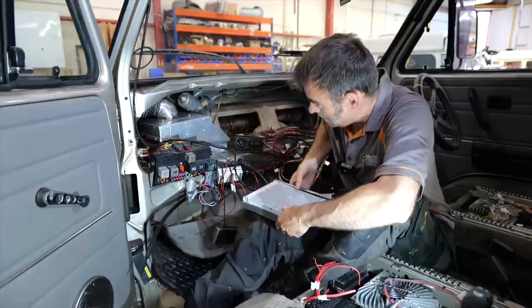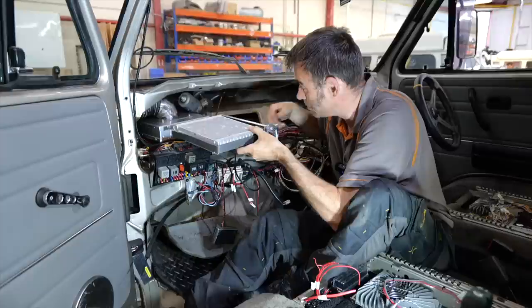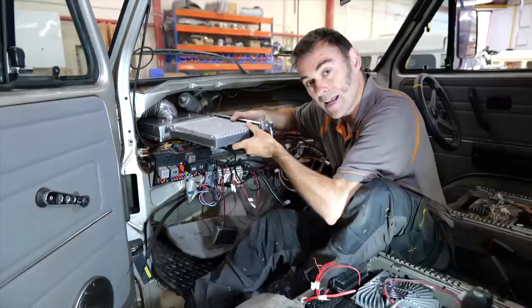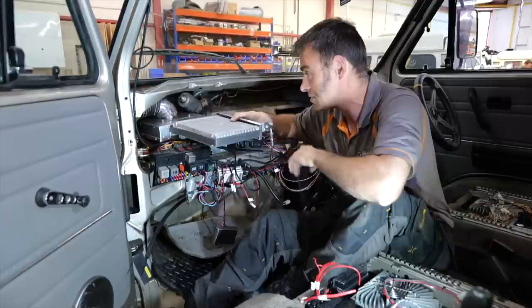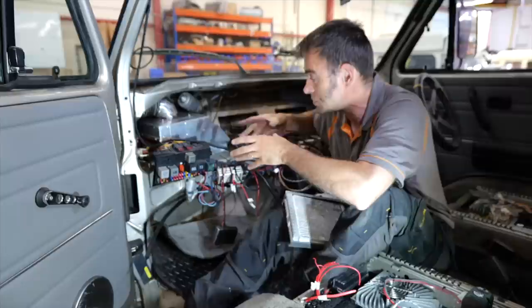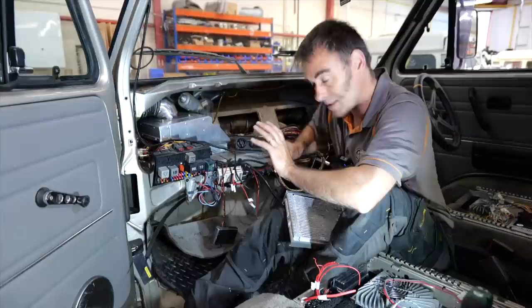When you're in Egypt, you're going to need the air conditioning evaporator. Outside is the fan that feeds fresh air through, then the evaporator sits in there and blows cool air through into the air box. To get air conditioning into one of these electric conversion vehicles is a complicated thing because not only do you have to put in the electric compressor, but also the condenser at the front, all the pipework, the evaporator, and then incorporate that into the existing air boxes along with the AC ECU. It's going to be temperature controlled — not just an on/off thing — so you need thermostats and be able to set the temperature. It's not as easy as you might think.